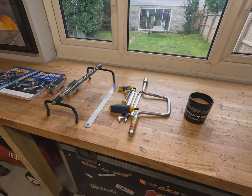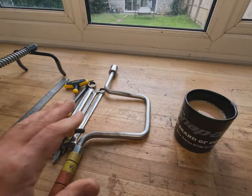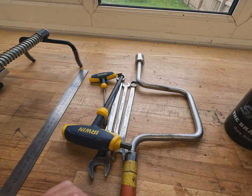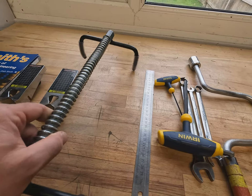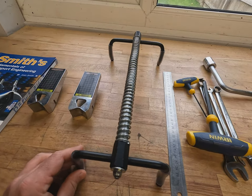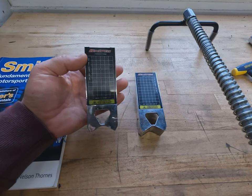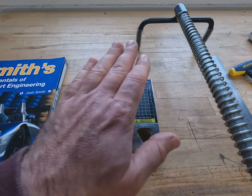There are a couple of specialist tools you'll need. Most importantly, a nice cup of tea. You'll also need a selection of allen keys, spanners, and sockets depending on your caster and camber adjustment setup. You'll need a steel rule, ideally something to lock the steering wheel in position unless you have a helpful friend, and most importantly a set of decent laser tracking gauges. These are Sniper version ones — quite old now but they still work very effectively — and you need these to accurately set your front-end alignment.